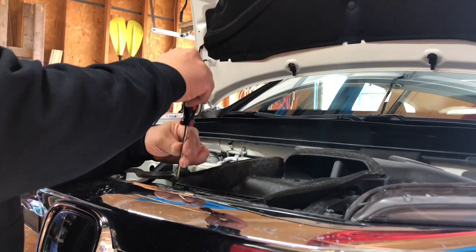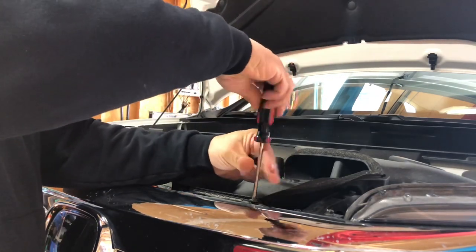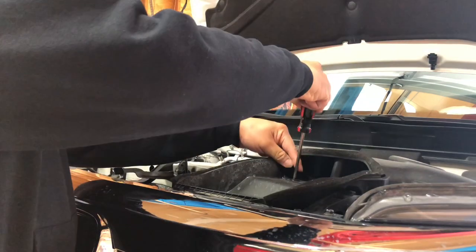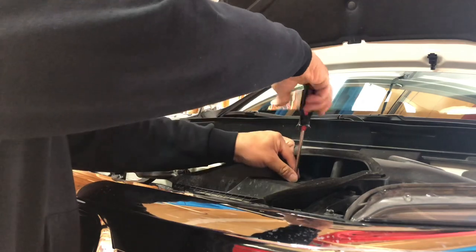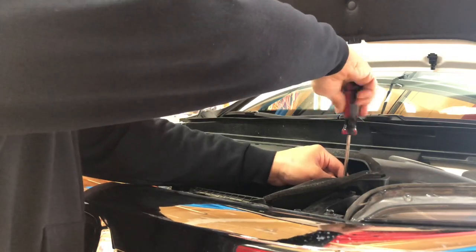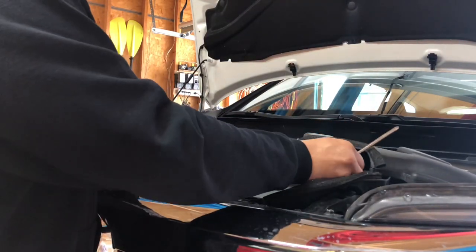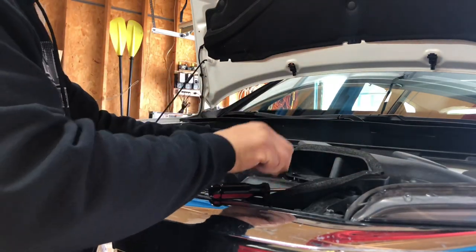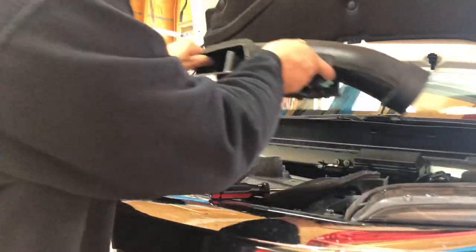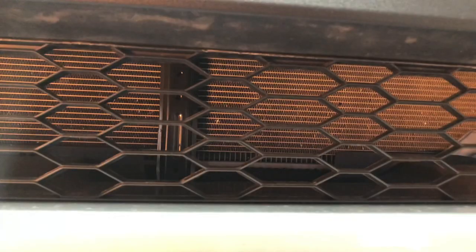To get this intake off there's a series of four plastic screws — we'll just unscrew the tops. Be extra careful not to drop any of these. Pull up and pull your clips out so you don't lose them. There's the battery, just so you can see it — that's why I did all that.